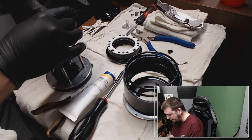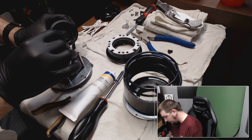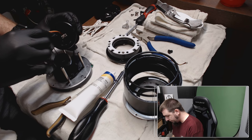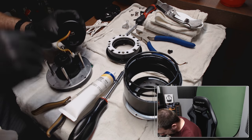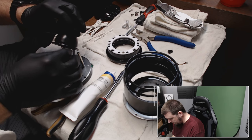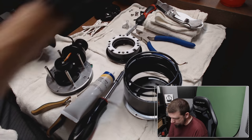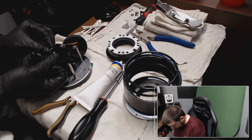When you put this together, something I found out last time almost too late: these wires run on one side. If you look at the inside of the gimbal that you're going to funnel them through, there's a notch cut out — for me it's on this side. So I know this goes up here on this side. Oh — we forgot the other plug. My finger in there, find the little notch, the little notch goes in the top.